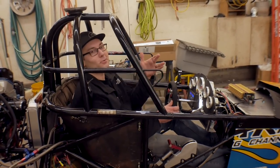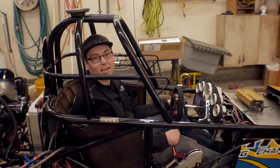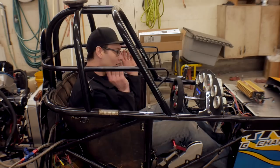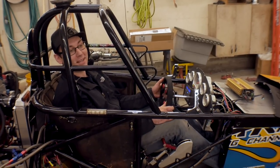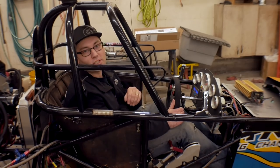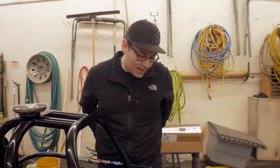Hopefully I can run the wheel on the guy and get to the line just in time. Hopefully my win light comes on — if not, you guys see my reactions in the videos. Let off the throttle, watch the oil pressure as I'm hitting the brakes. As the oil pressure is going down, if it's going down too much I'll let off the brake a little bit — that's kind of how I slow the car down, by watching the oil pressure gauge on the dash. And that's pretty much it. So I hope that answers your questions, Jim. That's kind of how I go about a pass in the race car.